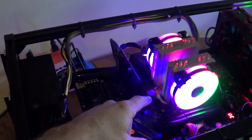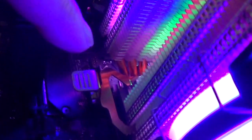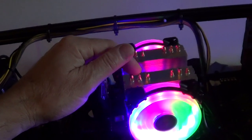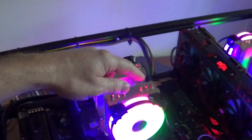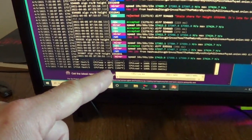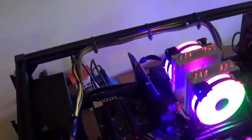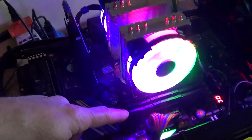These CPU coolers are better than factory — and the 3950s don't even come with a factory CPU cooler. What's nice is that there are six tubes with alcohol in them, and each end has a heat sink. I typically run around 70 degrees C. If you keep your CPUs below 80, they'll last forever.